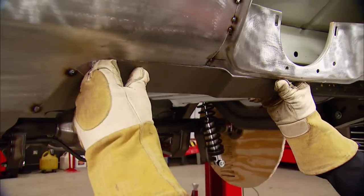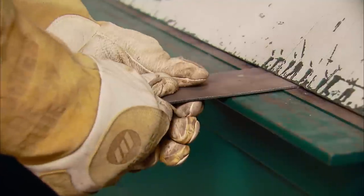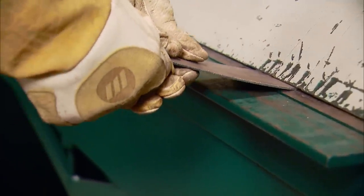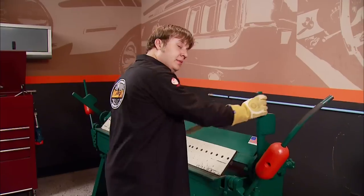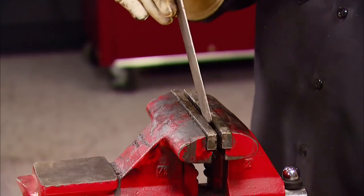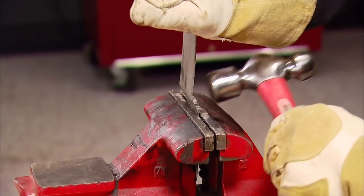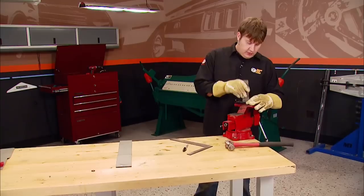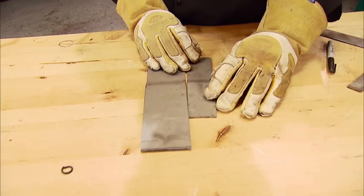When I made this next piece, I used our Tinsmith metal brake to put some bends in it. To make a gradual angle, I bent the metal by hand instead of using the lever. You can make something similar using a vise — just stick the metal in and do your bends by hand or use a hammer to gradually work it over. If you're doing a larger piece, you may have to cut it into a smaller section to fit into the vise. But the end result, if you take your time, will be pretty much the same.